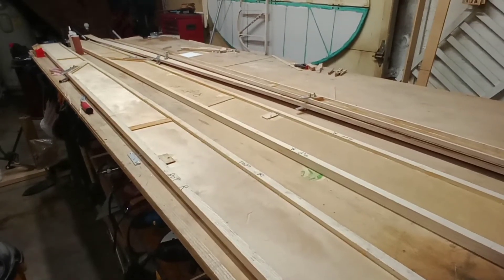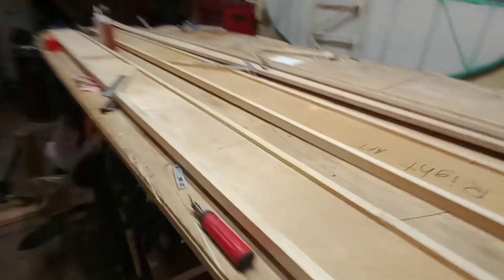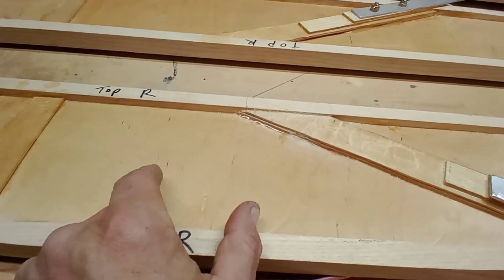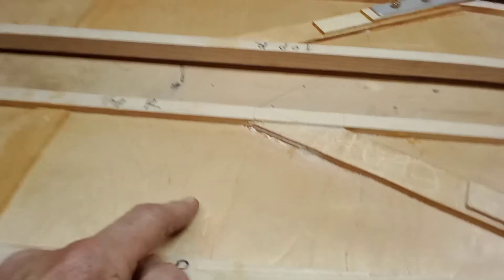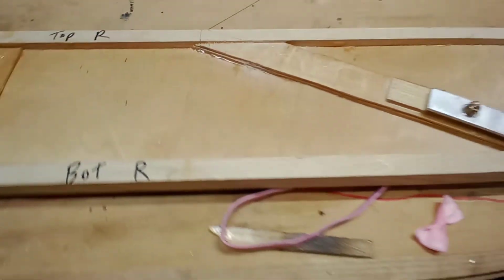I set it towards the high end — if not 70, at least 65 inch-pounds — and you're well above 50. I do torque all of the hardware on the wing. Anything where I'm not concerned about drawing washers down through wood — like when you attach your pulleys for aileron cables — you're not going to want to fully torque those. Just want them seated in there good, that's it.